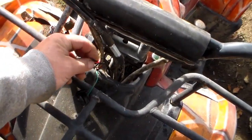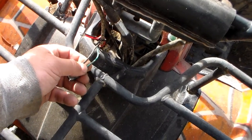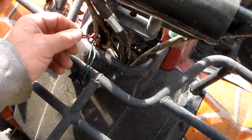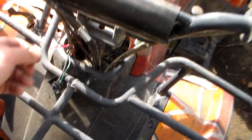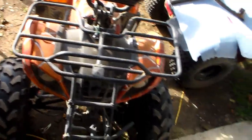I'm going to put a toggle switch here for the time being. If you short the green and the black and white together, that's the off position for the switch — that turns off the motor. If you short the red and black together, that puts power to all the circuitry so the starter button will work, your lights will go on, and it turns on the 12-volt piece of it.